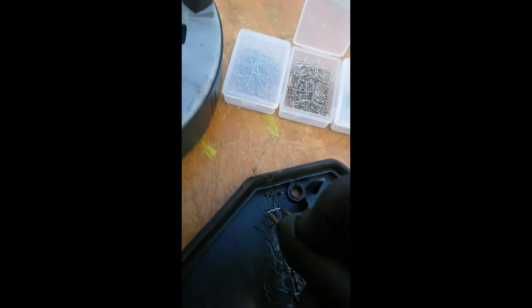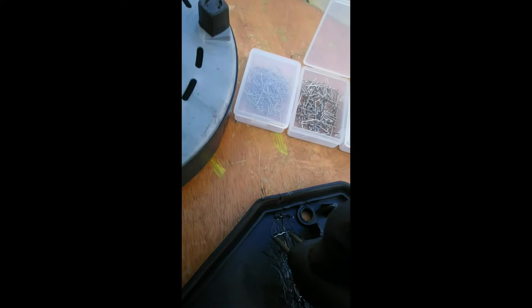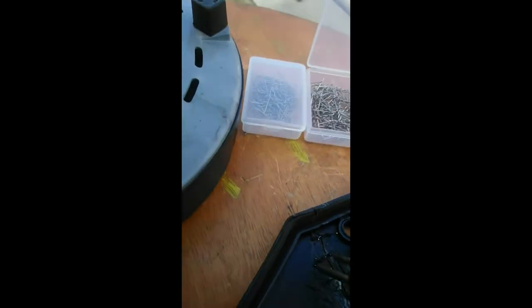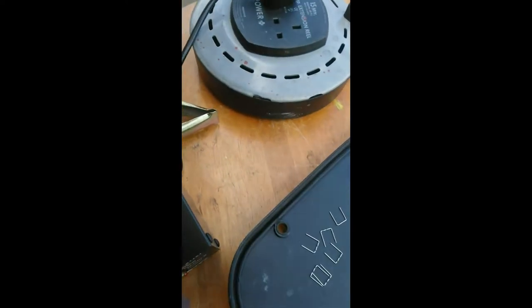So you simply position where you're going to do your staple, like that. Just hold it gently. You don't need great pressure. The heat does the work. Then I switch it on. I'll have to look at it myself, guys, because I can't see through the thing. There it is. It's starting to melt in. Starting to go down. So I keep applying the heat until I get it down to a depth that I'm happy with, which to me is about there. Let off the heat. And one solid stapled joint.